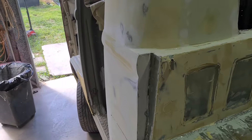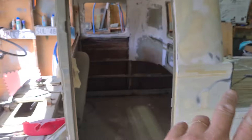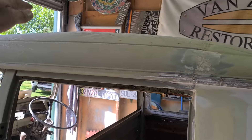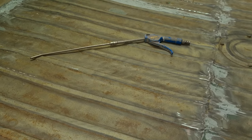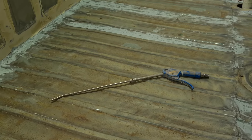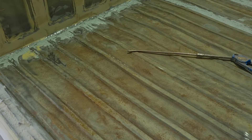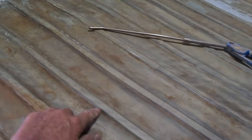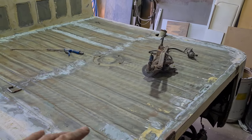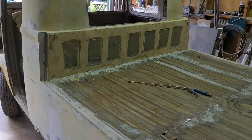This vehicle is from Brazil and it was originally a van — it had a roof that came up. So this here was the original floor, and when I was cleaning it off the other day to fill a few holes, I noticed all this is hand-beaten. The guy in Brazil would have been squatting on the ground doing this with a chisel. You can see the factory pressed seam — nice and neat — and then his version alongside it.